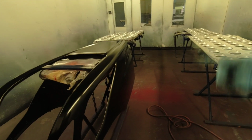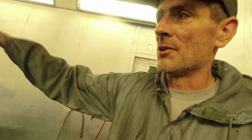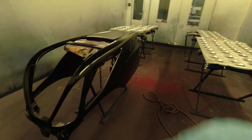We'll move on. I might clear coat this one first, coat down on this so it's wet, and then I'll just blast these out with the DV1S, and then by the time I've done them, I can go straight onto the second coat on this one. Second coat now. So I'll drop you a little bit of footage with these. Nothing special, and then we'll do the full bit of footage on the bonnet, and I'll put the gun settings that I'm using at the top of the screen.